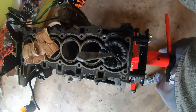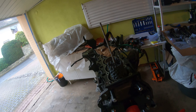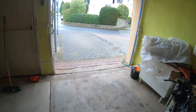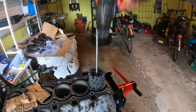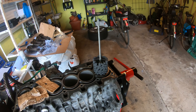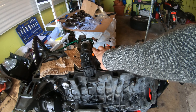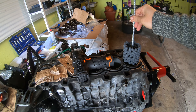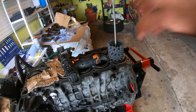It seems to fit perfectly — it's the exact bore shape, 81 to 83 millimeters. We're going to put this on the end of a drill and douse it in oil and WD-40. All we're going to do is drill in and out, maybe 20 to 30 times, just for 10 seconds. I'm going to turn the block so I can get it perfectly at a straight angle — we don't want to be honing at an angle. You want to go in and out, and don't stop the hone until you pull it completely out. You don't want to stop the hone while it's in the bore because the crosshatching pattern can be disturbed.